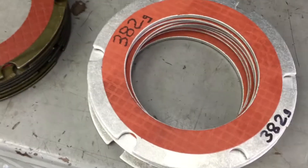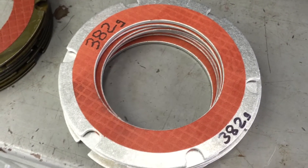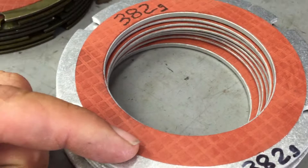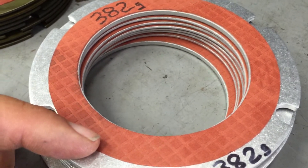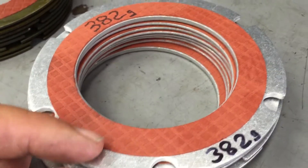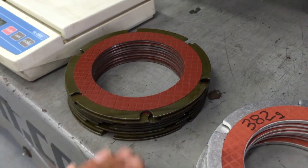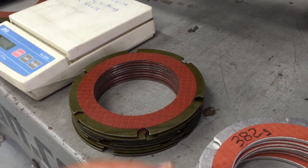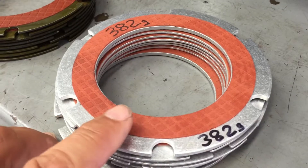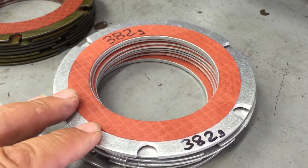The Kiwi plates have this red friction material - we call them an easy release clutch. They release way easier than the stock Indian one. We've actually developed a particular grade of material and pattern that gives you a good feel so when you're taking off you can actually slip the clutch. Some materials are more in-or-out - they either bite or they're disengaged. These ones we've put a lot of testing into and they'll give you a nice feel so you're always taking off smoothly.